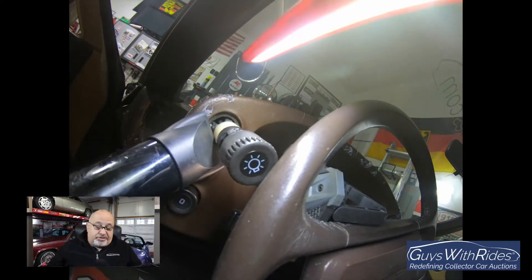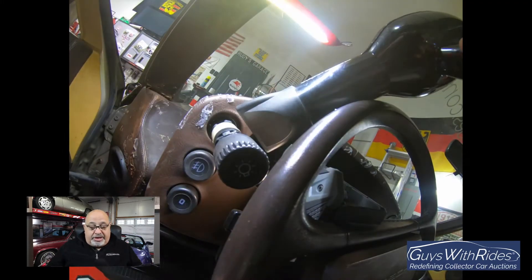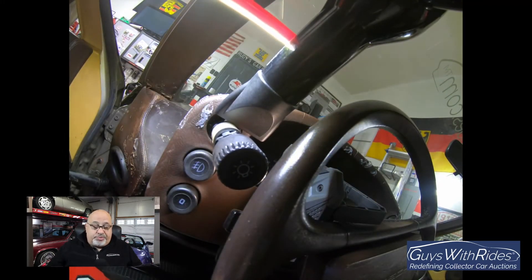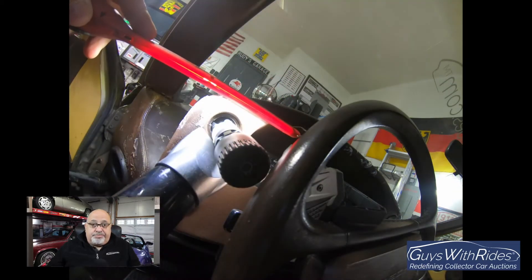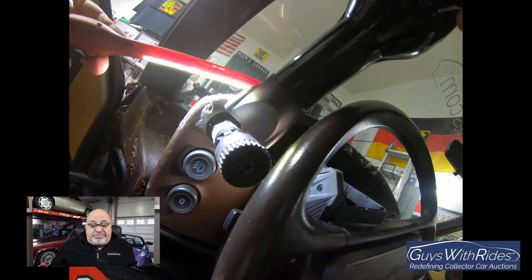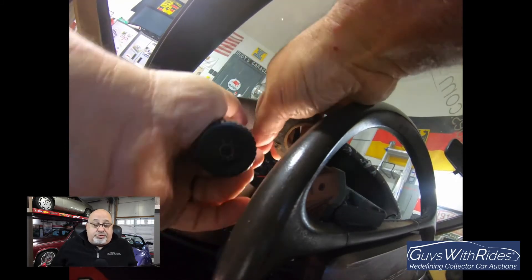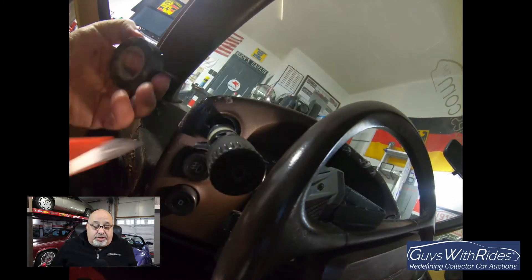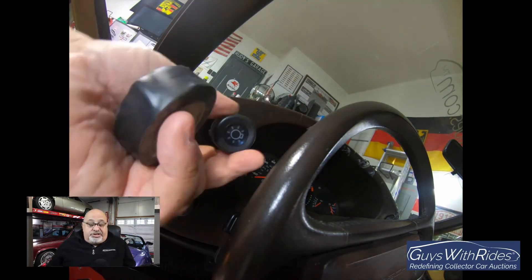With all 10 connections on correctly, I validated that all of the wiring was correct, then used a hair dryer to shrink the tubing onto the wires to give a nice protective bond so nothing shorts behind the dashboard. Then I did one more round of electrical tape just to make sure everything was good before pushing the switch back into place.